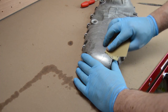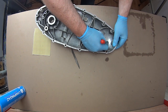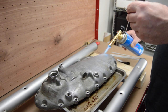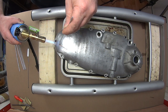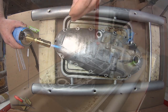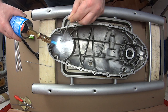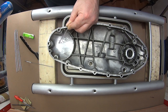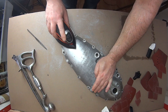First steps were to remove any loose flakes and sand off any oxidising. As with any alloy work you need to pre-heat the material, so I bunged it in the oven. I noticed the solder wasn't flowing through the crack, which I suppose is due to the lack of wetting agent flux. So I turned the case over to apply some solder on the other side - possibly a bit too much actually. With the solder set I could knock the top off with my body file and start to finish it with the sander.